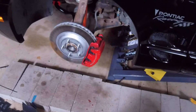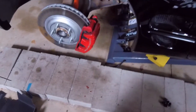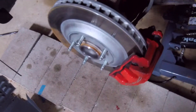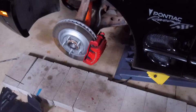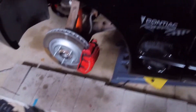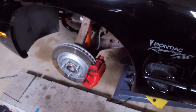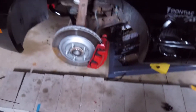I'll make a whole video on the C5 brake kit later on, but overall I think it is an improvement over stock. This hub is kind of shiny because I just replaced it — it's a brand new SKF stock replacement hub. I did both sides, and I seem to be still running into some pad knockback issues on the racetrack. Apparently these General tires are a little too sticky for the stock hubs, so I might have to get one of those SKF X-Tracker hub adapter kits. I was kind of hoping I wouldn't have to do that because it's extraordinarily expensive, but time will tell.